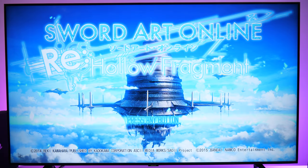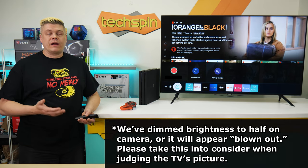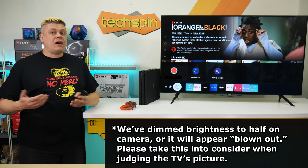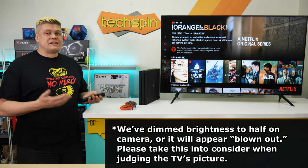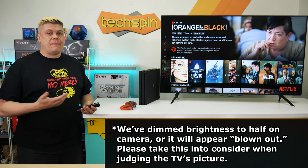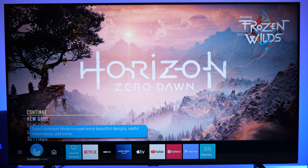With a kind of retro opening animation, we were unimpressed with the out-of-box experience, as the default settings have fairly low brightness. Considering what we saw in Costco versus what we got, we initially thought there was a problem. We fixed it by setting the brightness slider to max, gamma selection to 2.2, and picture mode to vivid — called dynamic in our region.